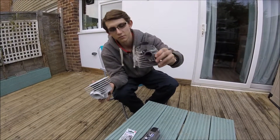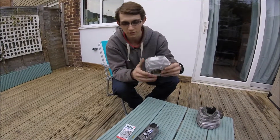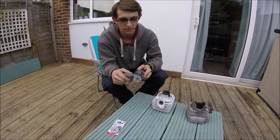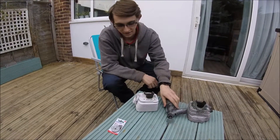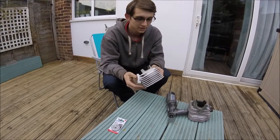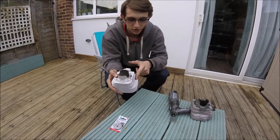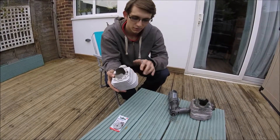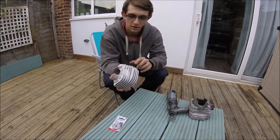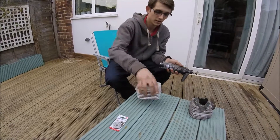That was a rough first attempt on my bore, and now we're doing it again properly on this one. All you really need is a Dremel and some decent cutting discs. Because it's an aluminium bore you're cutting, it makes a horrendous amount of noise, but all you need to do is cut a nice straight line all the way along the fin — make sure not to go too deep and not to hit anything else, as you don't want to damage the structural integrity.